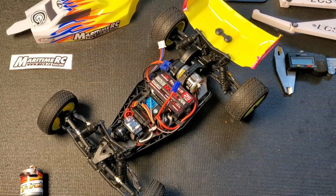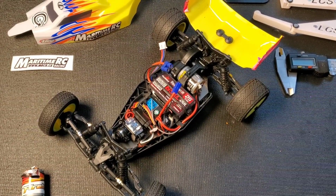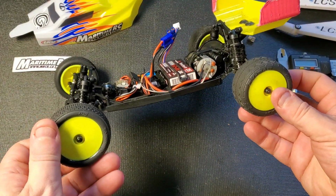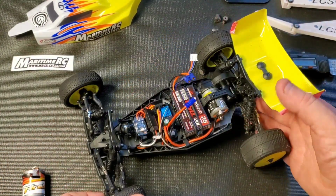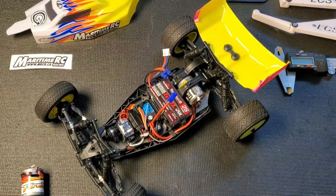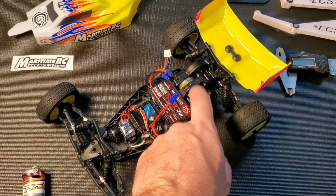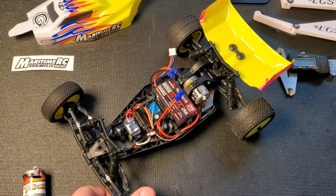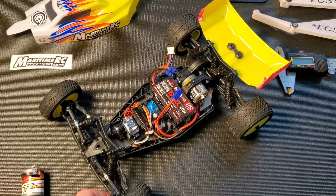So what I did is I ordered in one of the new JR's Choice motors, which is a replacement for the Mini-B, and it also comes with the Mini JRX2, and that motor is a 42 turn motor, where the stock motor is a 47 turn motor, so it should have a little more performance. So we'll give that a test in the next video.